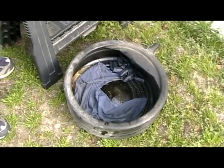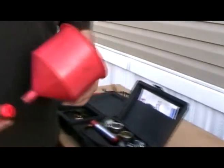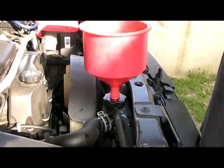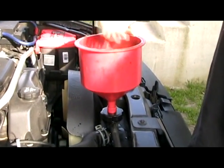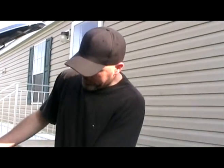I also got a big catch can for catching large amounts of coolant. This one here is what's called a spill-free funnel. You put these little fancy adapters on, screw it down, fill it up, run the engine, and let all the air purge out that way. It's really great for not making a mess. There are other videos on this particular tool on YouTube, but just like the pressure tester, you have to have the adapters for all your vehicles.